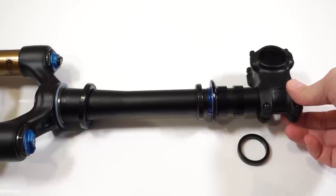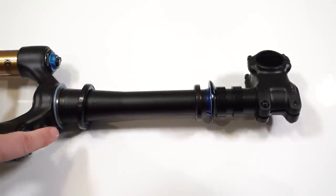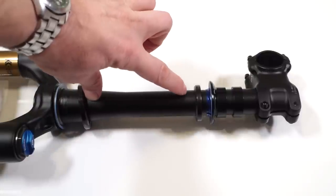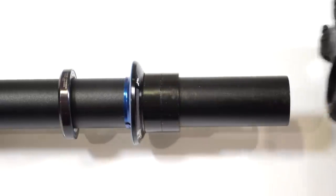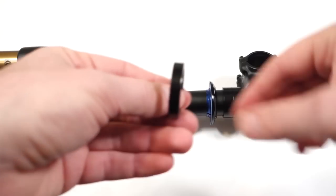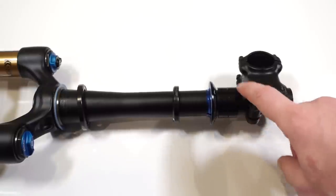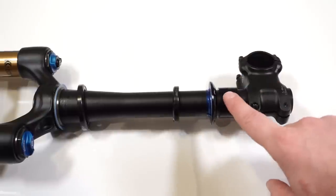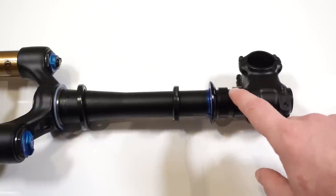For this next step you're going to need your stem and also what's called the headset spacers. So you have your crown race centered onto the bottom bearing, then the head tube from the frame, the top bearing, the top cover, then spacers, and then you fit in your stem. These spacers just lift up the stem a little bit in case you want to adjust your cockpit. Unless you really know what you want, I'd highly recommend installing at least 20 to 25 millimeters of spacers to start with, then trim it down later when you know.